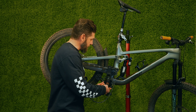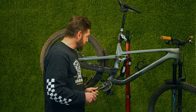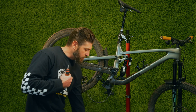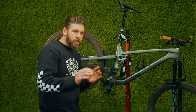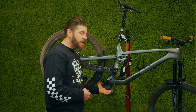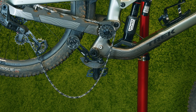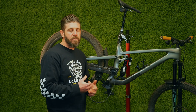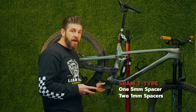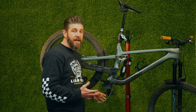We'll take our 8mm Allen — we've already pre-loosened this — and pull the crank off. That's not needed on all bikes, but with the SRAM crank it is definitely needed to access the chain guide. Essentially what Trek has found is that most of their bikes were only shipped with a 5mm spacer between the ISCG tab and the chain guide. The service bulletin calls for 7mm of spacers: one 5mm spacer and two 1mm spacers for a total of 7mm out from that ISCG tab.